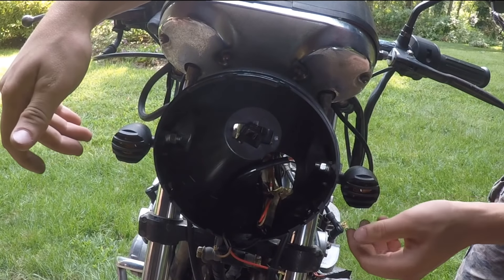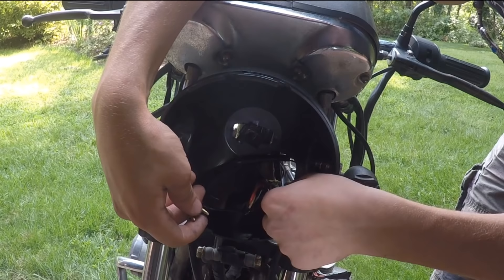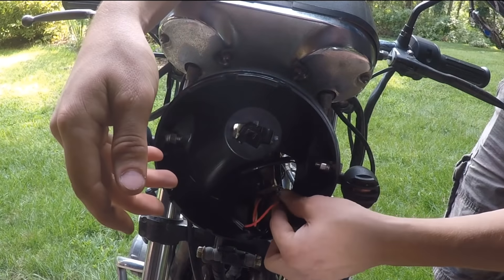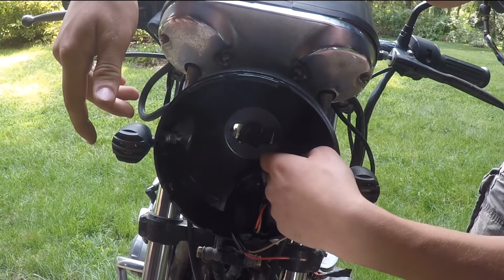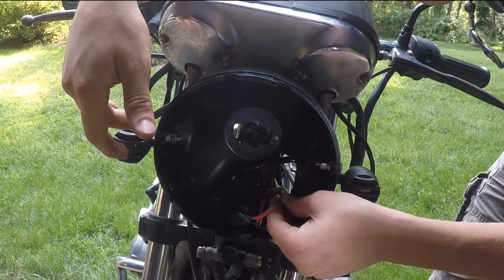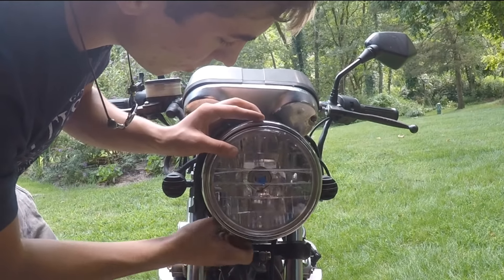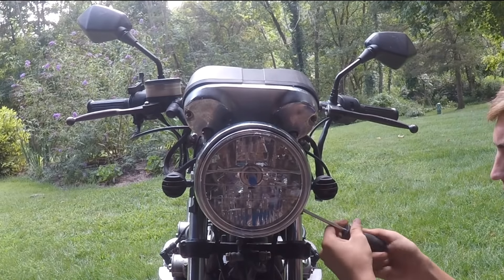I have a white-greenish wire from the wiring harness that goes to the right turn signal. I've connected the brown and red wires from the turn signals — the running and turning light — together, since the bike came stock without running lights in the turn signals. There's another black wire without a white stripe and that's the left turn signal. I've already tested it and it all works. The goal is to pull all the wires into the hole on the headlight so it protects all the connections.